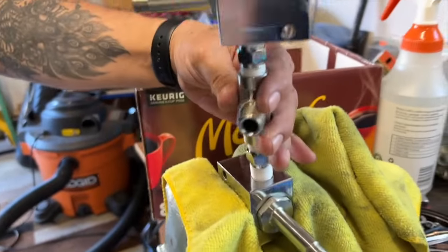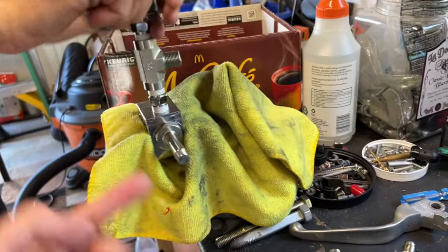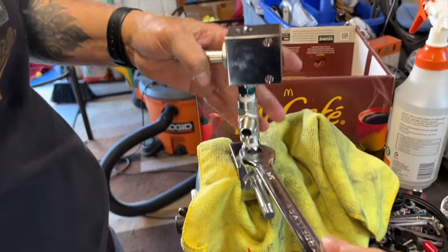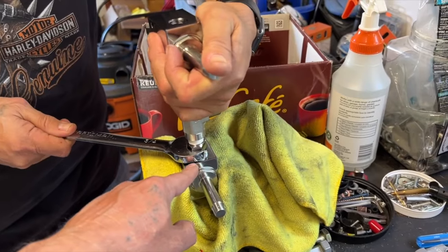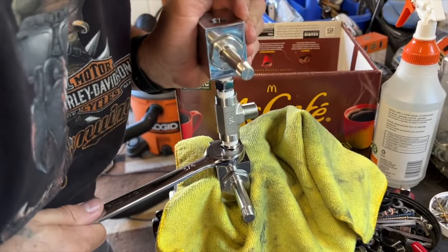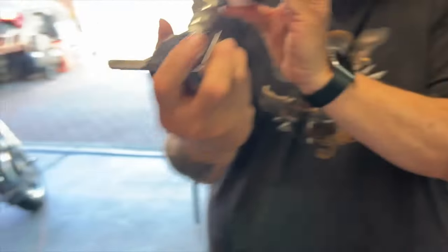You want to use a towel when you're putting your dumps together. Now that you have your T tefloned, this is the best way to tighten it. When you're done, the goal is to have both dumps facing you and the T at the bottom. We'll show you what that looks like right now. My brother actually has it already — it's a little bit off, so get it straight. Now that's ready to go on the car — straight as she's going to get.